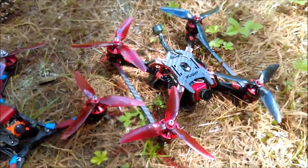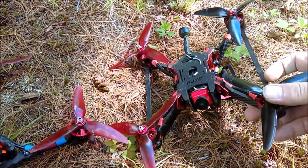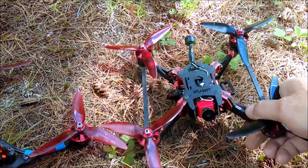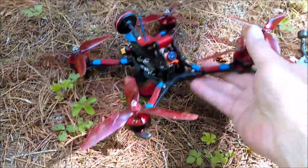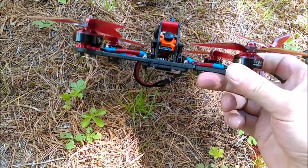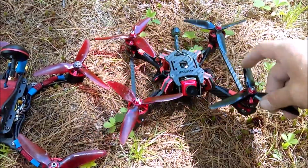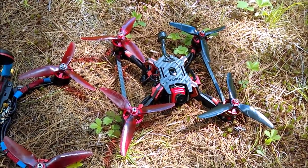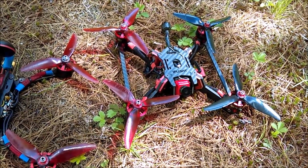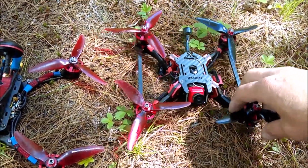The 2208, I guess they are, on the Vertigo. This is kind of my practice frame here because it's just a wicked bruiser. This thing will take a serious beating and just keep on going. So this is what I use for practicing. And then I just built this one the other day, so I have not raced with it yet, but this is what I intend to actually do some racing with in a couple weeks at an upcoming race. So the 2207 or 8 on the Vertigo, the 2450 kV, they're super efficient and nice and punchy. The thing flies super smooth and locked. This one is kind of easy mode, actually. This setup just flies so nice that it's super easy to fly.